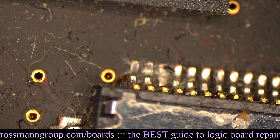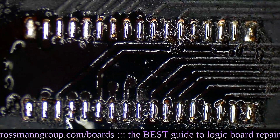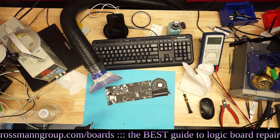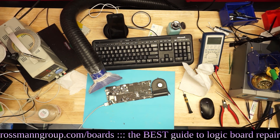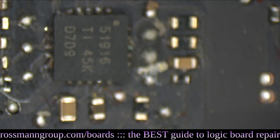Corrosion on the webcam connector. Dust on the JTAG connector. We've completed removing the dust from the MacBook. Take our connector, put power there, and turn the charger on. No fan spin — that would have been way too easy. What are you? I found you. Corrosion.